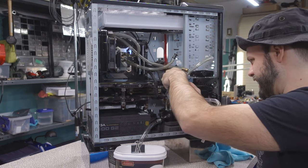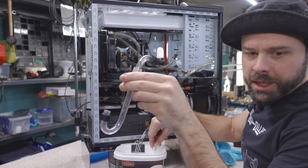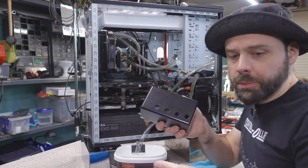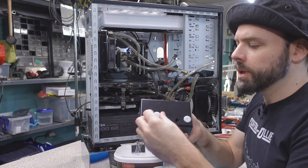Other than it's getting tangled up in wires here, she's coming out pretty cleanly. Look at these cute little J tubes. Now our card's draining out. I need more plugs. I think we'll be okay like this. So a pro tip when you're manipulating a part: I got these cheap plastic plugs, buy more plugs than you need.